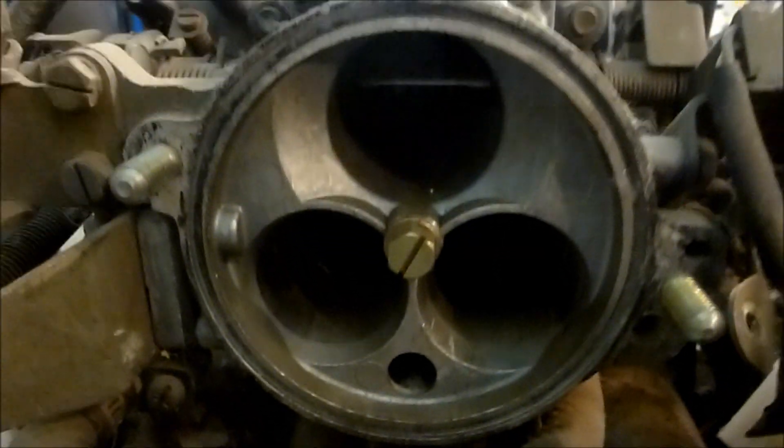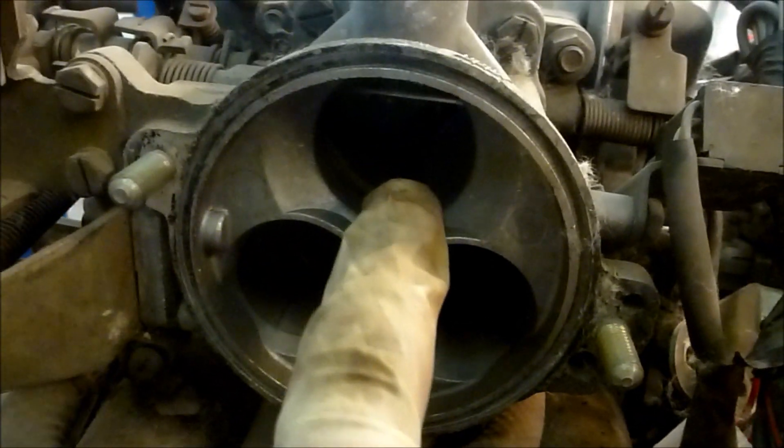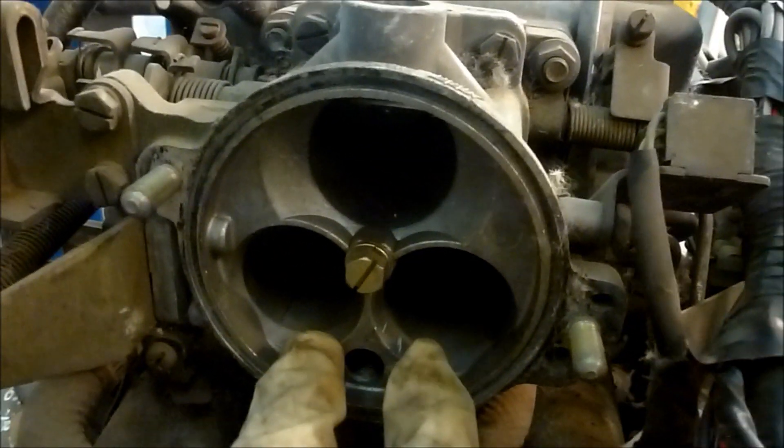You can see it is RE-EGI — it's a fuel-injected motor. It has four fuel injectors: two primaries and two secondaries. They are underneath here. You can see the progressive throttle body, which I've got propped open right now. This would be the primary barrel, and these two would be the secondary — kind of like a four barrel.